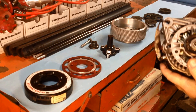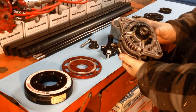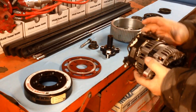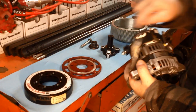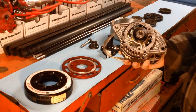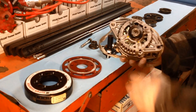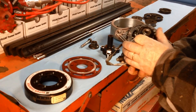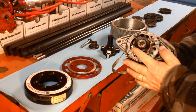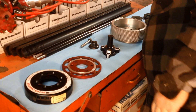I also picked up this really nice little alternator — a really cute little Bosch alternator. It's a really nice setup. It is a single wire integral regulator, it's got a nice ground strap on it, it's 14.5 volts at 140 amps. It's got a little small pulley on it. It's got a little problem with the one pulley because it's got a little dent on it — I think that's probably why they changed it out; somebody probably dropped it. But that's one of the things that's going to go on.